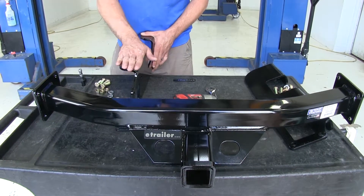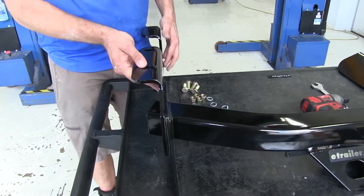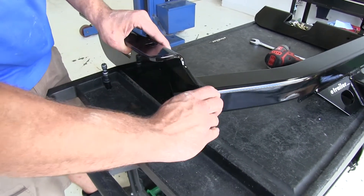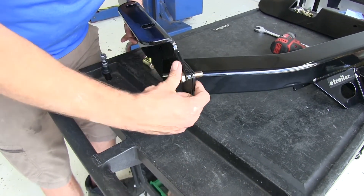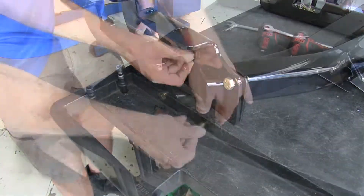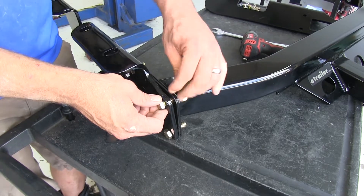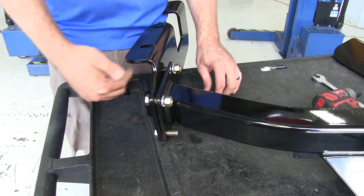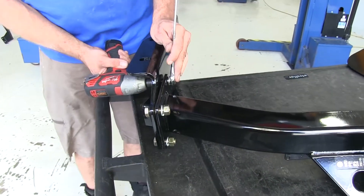To begin our installation, we need to get our side plates installed onto the cross member. These are just going to go right over the end of the hitch — the cross tube is actually going to come out through them. Then we're going to take our inch and a half bolts, these are M12s, and slide those through. We'll have four locations to do that in, and we want to place a lock washer and one of our hex nuts on each bolt. Just want the side plate lip, or that flange, to be facing out away from the hitch. Now we'll snug these down using a 19mm.